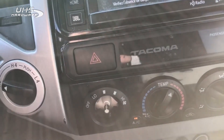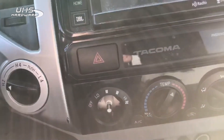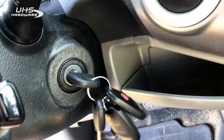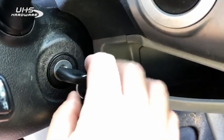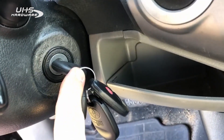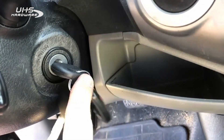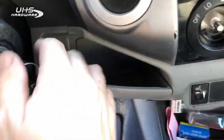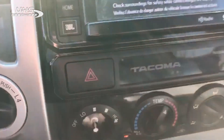The vehicle starts. But as soon as I turn it off again — push in, let go — it has nothing to do with the weight of the keys or anything, it's just the lock. Push in on your keys while you're programming. They will register. When you're done, once you turn the key, it'll push in the buzzer switch just fine and it'll start. Just be aware of that.